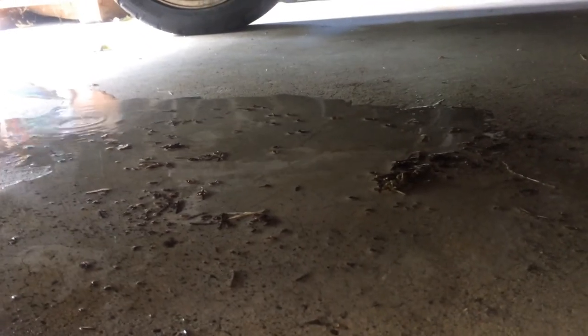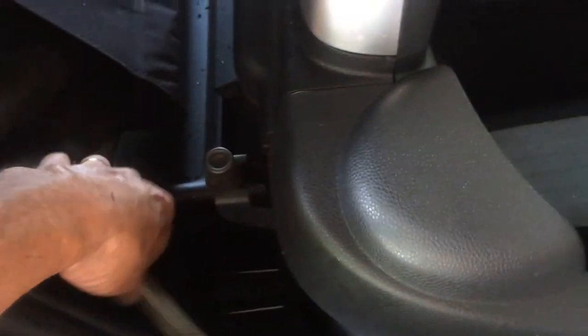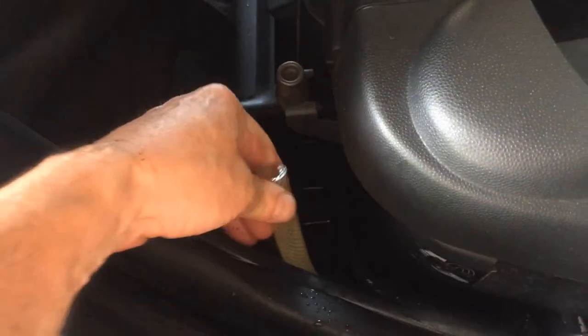I got the idea that I might be able to use a garden hose to just squirt down there — and I can hear it draining underneath. Look at all that stuff that came out! This car had been parked under a bunch of pine trees for several years, so the drain hole was definitely clogged up pretty badly. The hose helps a lot to enable the trombone cleaner to be forced in initially, and then flushing with water has worked out really well. Hopefully that'll help somebody out.